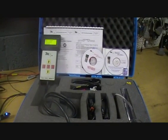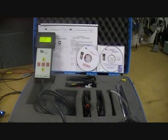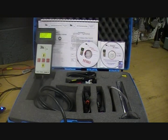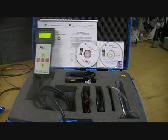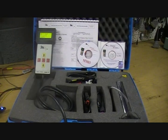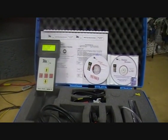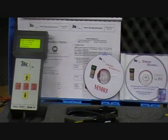Management and control testing of the pressure regulating valve and inlet metering valve efficiency by driving them with the MM03 independently of the ECU. It also allows the operator to vary the Common Rail pressure when doing back leakage tests. Also, when used in conjunction with a hand pump on the bench, you can drive the injectors, both coil and piezo, allowing you to test the minimum injector release pressure and view the quality and uniformity of the spray pattern, as well as checking the back leakage on the bench.